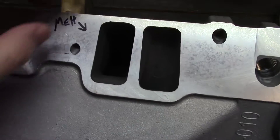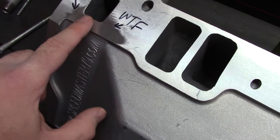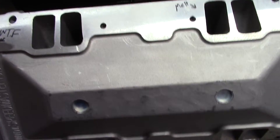There's also a nice scratch over here that you can feel, but I use gasket sealer anyway so I'm not worried about that. The bump being positive means I can grind that down, and I'll probably put some RTV around the water ports. But for anyone who's new to this and just wants to slap this thing on, so far it's not looking too good.